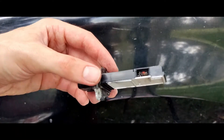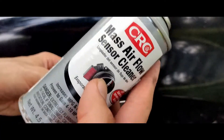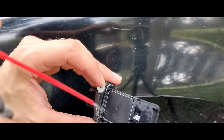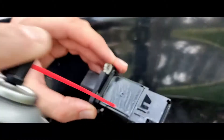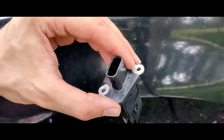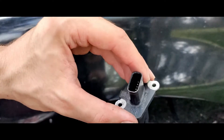You want to make sure it's fully dried out and evaporated before you start the truck — that's what the instructions say on the back of the can and we like to follow instructions. You can also spray on the outside to make sure there's no dirt that'll eventually work its way back in. Now is also a good time to get some contact cleaner and spray in the electrical connector if it's dirty.